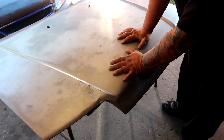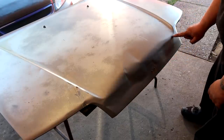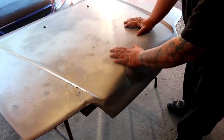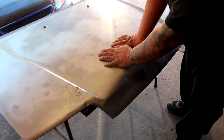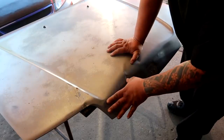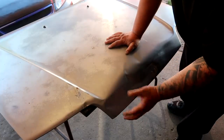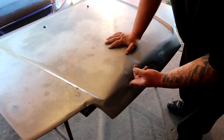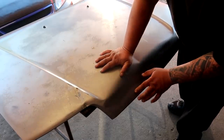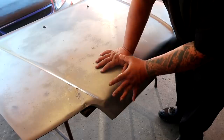Online I was reading about this — it's pretty bad. This giant hump is not supposed to be here, and the line in the front of the hood is completely gone. I'm going to have to mark out where that line is supposed to be. This is a giant high spot — I'm not sure if I could just push down on it; I think it'll be worse if I do. According to the videos, sand it down to bare metal so the stud gun can find bare metal to weld to. Some videos say start on the outside and work your way in toward the lowest point; others say start at the lowest point — the valley of the dent. It's all about massaging the panel back to its former shape.